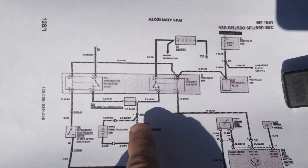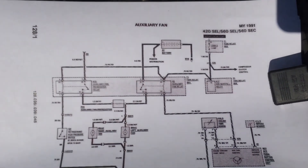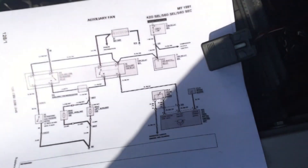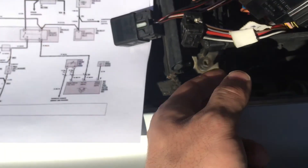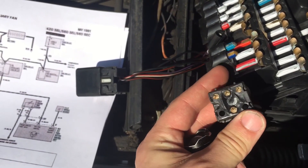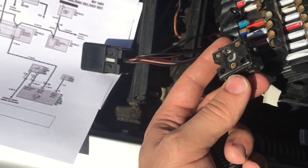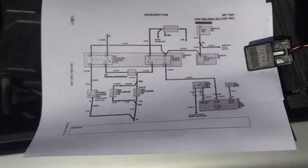There's a good bit of safety there. The first problem is you can see this got pretty hot and melted — I think it's just a bad connection where these main power wires go into this relay plate. The other problem is that the slow speed quit working, and I initially thought it was just that resistor.